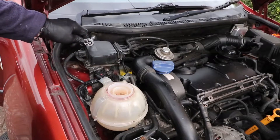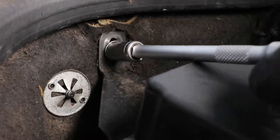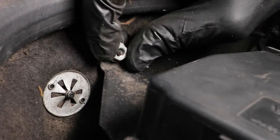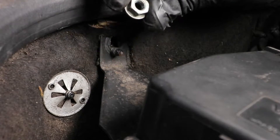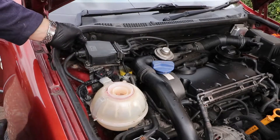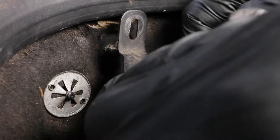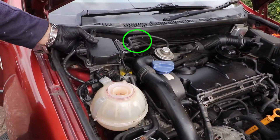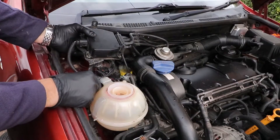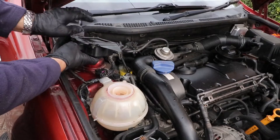Undo and remove the nut holding the vacuum unit to the bulkhead. Then lift off the bracket from the threaded spigot — you'll have to bend it forward slightly. Also detach the vacuum hoses on the bulkhead, just here. Once the whole unit's loose, you'll be able to lift it off and turn it upside down, which clears the area to remove the expansion tank.